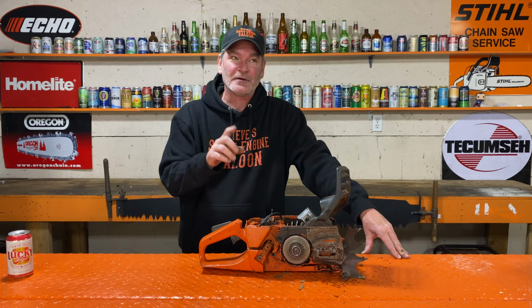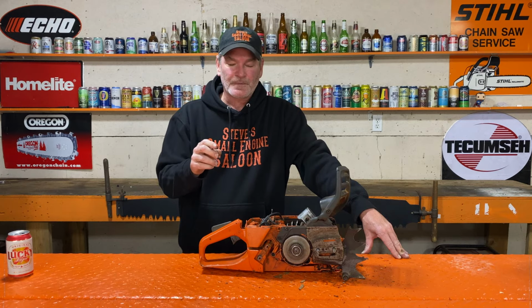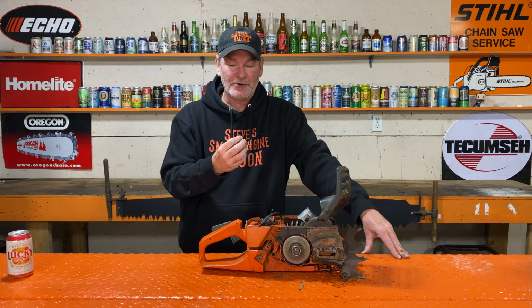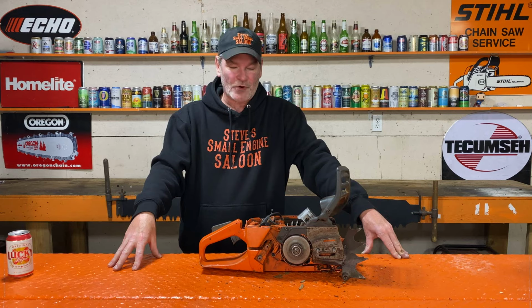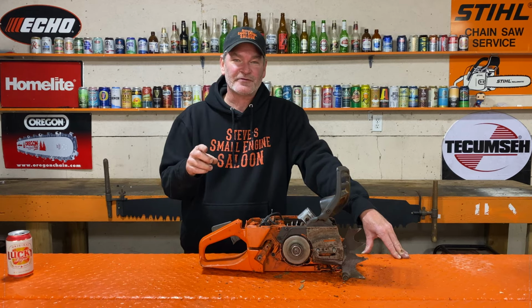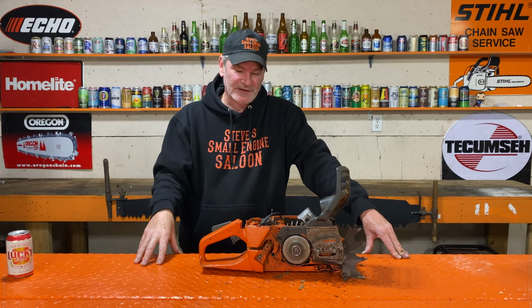So why did that happen? From memory, I did a warranty job once when I worked at Walker's Saw Shop. It was on a Stihl BG86 handheld blower. Same thing happened. That little thing came out, and it was under warranty. So I phoned my service rep about the warranty issue, and he said the only way those little shields can blow out is from overspeed. The bearings are turning faster than they're designed to turn, and that will blow those things out. I don't know if that's 100% true or not, but he's the service guy. He should know. So did it overspeed?